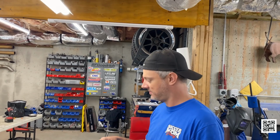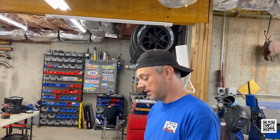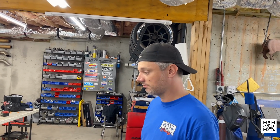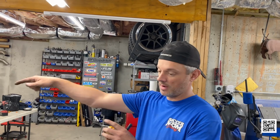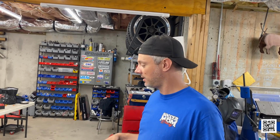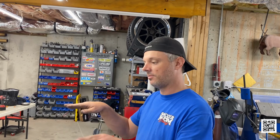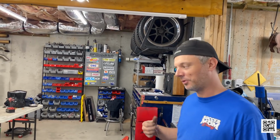Hopefully we can at least get the wheels pointed straight, because if they're straight to the string, then they should be, because these are machined and this is the same bar front and rear. If you center the rear and center the front, the strings should be parallel to the center line of the car. And then you measure the front and back of each wheel. It's better with bigger wheels because you get a wider spot that you can measure, and we're assuming that the wheels aren't bent. So that's another thing that could throw us off a little bit here.